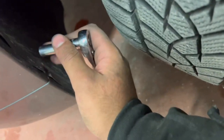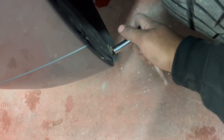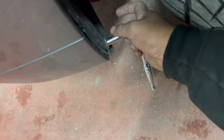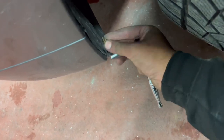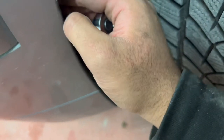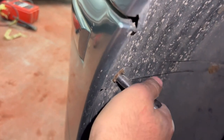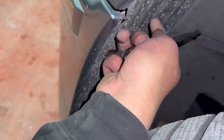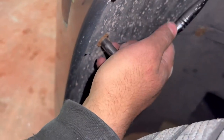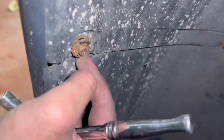My bad, it's a T8. Two T8s with that - first one here. You've got to be careful because these are pretty rusted, it's easy to round them off. I've got to replace them. There's another one just there. Easy to round off - got to put a load of pressure around it using that to keep it flat and supported, putting all the weight, not much pressure, and just gently. That's it. Because it's pretty rusted as you can see, so if you round that off it's just extra headache.